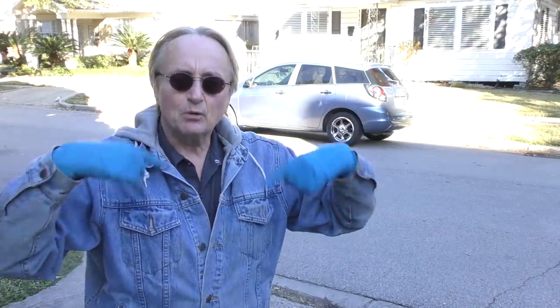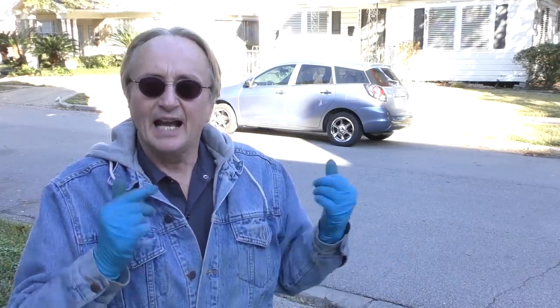I had an argument years ago with my Matrix there. It would slip when you took off fast, especially if it was a little bit wet outside. And it had really old tires that were 7 years old on it. But I thought, well, I'll change just the front ones so they'll have better grip and they won't slip, and they'll ride better, right? So I go to the tire place and say, I want two new tires on this in the front. And following the stupidity of many companies these days, they didn't listen to a word I said, and they sold me two new tires, but they put them on the back.